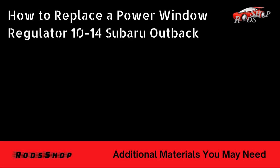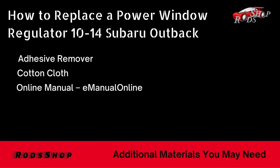Here are some additional materials you may need: adhesive remover, a cotton cloth. If you would like a step-by-step guide, you can go to an online manual. The reason why I'm telling you adhesive remover, there's a moisture barrier, sound barrier, piece of plastic behind the door panel, and it has this black goo that's all over it. It tends to get over everything.